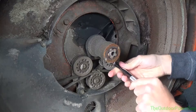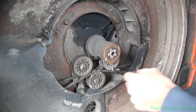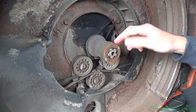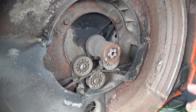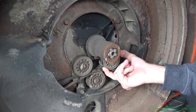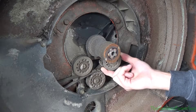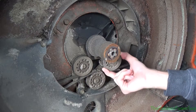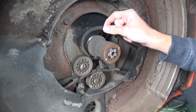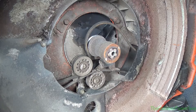While I'm getting the blade adapter off, I'll talk about why most repair shops will not straighten crankshafts. One reason is liability - a shaft can be so bent that it can actually break, and a broken crankshaft means no motor. Another reason is that most repair shops also want to sell you a new motor or a new mower. I have a crankshaft straightener and, at the customer's request, will straighten a bent crankshaft. This is actually my own personal mower - that's why I don't loan out equipment anymore, because they usually come back broken and torn up.